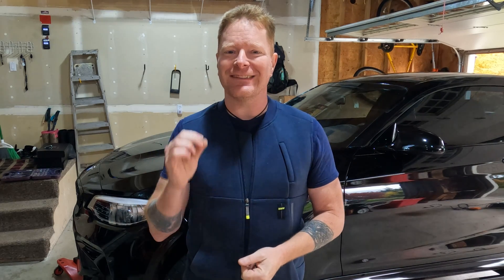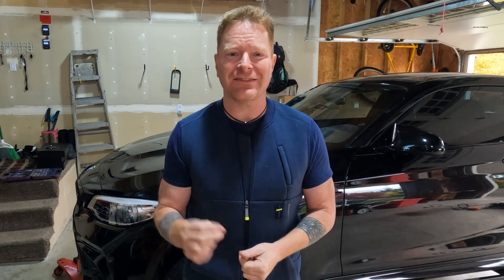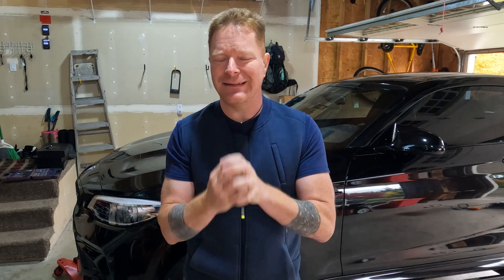The other thing is hotter exhaust temperature is better — the less that radiates out, and the more that's kept in those gases means those exhaust gases actually move faster and are exiting your exhaust even faster. So you get more temperature out the back, and less temperature radiated into your engine bay. Funk makes a fantastic set of downpipe blankets that we're going to install. We have to work them around our O2 sensors, but we're going to cover our downpipes to trap as much heat within the downpipes and out the exhaust. This is what race cars do to extract maximum power, and it will also reduce engine bay temperatures in our street car.